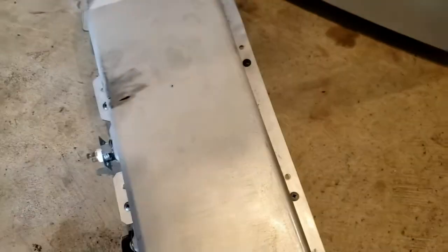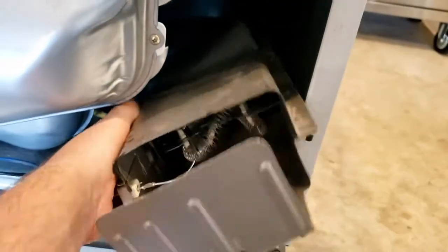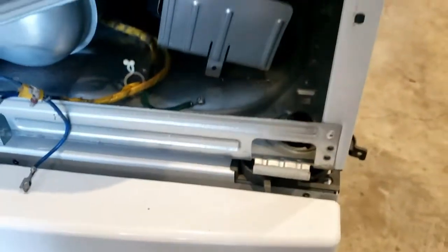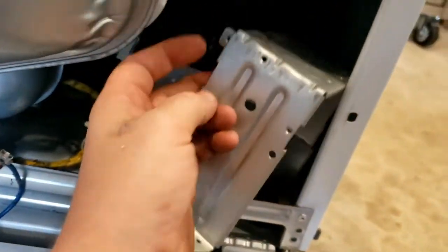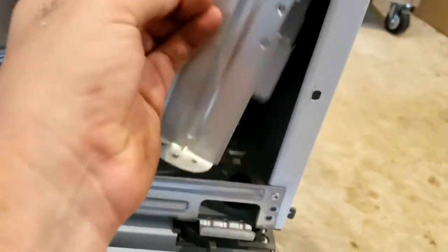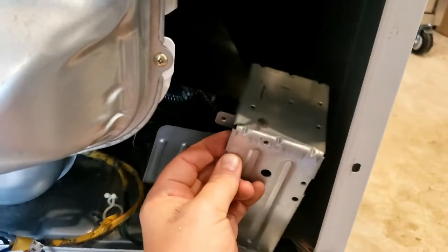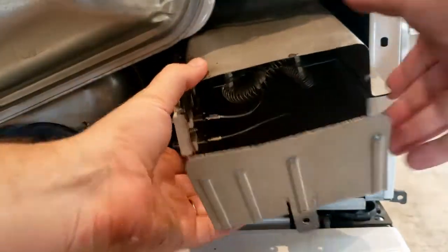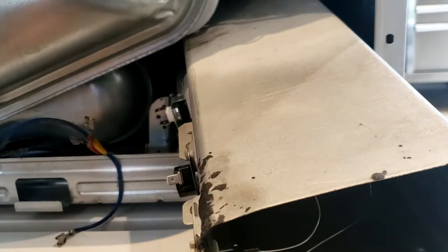When we go to put this back in, remember the order we took it out: the heating element goes in first, and then the bracket. Once you install the bracket, it clogs up the entryway and there's no room to put the heating element back in. So put the heating element in, then put the bracket in once the heating element is back and out of the way. With the bracket on its side, we have a little room to slide this assembly back. We're sliding it back out so we can reach all the plugs and connect the wires — some of them are way back there.